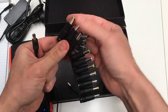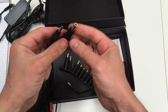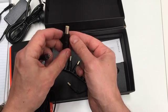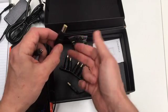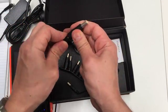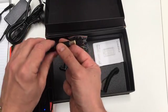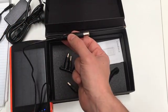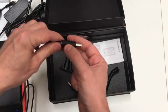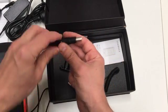For instance, this one here, they're all marked with letters. And as I said, in the description of the product, you can match it up. So for your laptop, whether it's a Dell, whether it's a Toshiba, whatever it is, you can figure out which tip fits it, and also set the voltage, connect your tip up. This goes straight into your laptop. So it's quite a neat little product for charging laptops. This has fixed the problem that a lot of people have had with power banks as of late for laptops, because they're only outputting 5-volt USB. Now you can actually charge them with this.